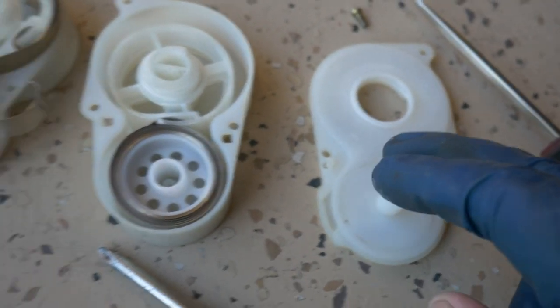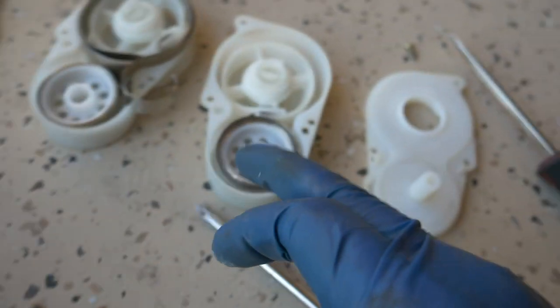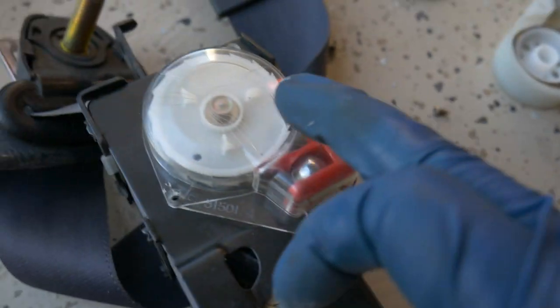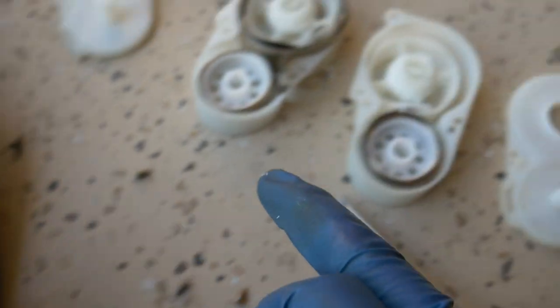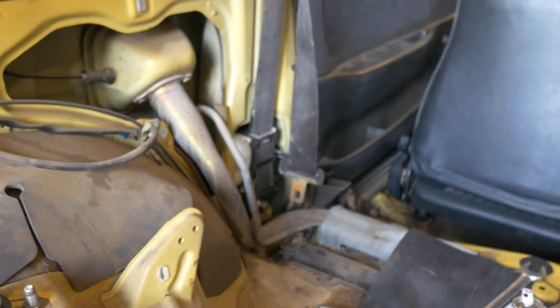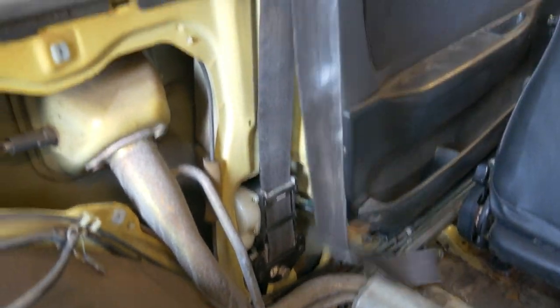So I had to figure out, these belts were locked. We were trying to figure out why and we couldn't get it out. But after removing this and also the little magnet with the ball, we were able to diagnose why we couldn't get those back in. And I actually removed that little white unit and I applied it on my SI belt. And I have it retracting now.